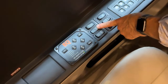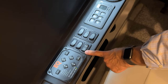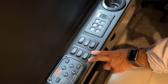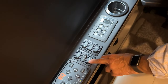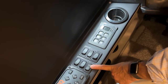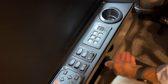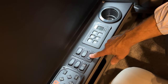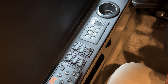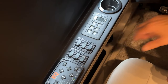If we turn the engine brake on, we can use the engine brake on high, medium, or low settings. If it's off, those settings aren't available — this must be on to set the engine brake. The rocker switch in front of that is the air horn. As long as the coach is aired up and you have air in the system, the air horn will work. If it's turned off, the street horn works; if it's turned on, you'll have the air horn.